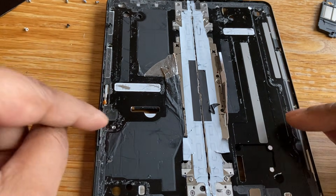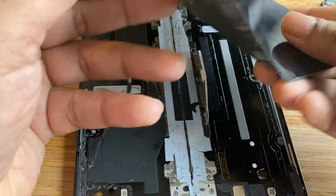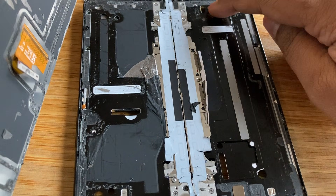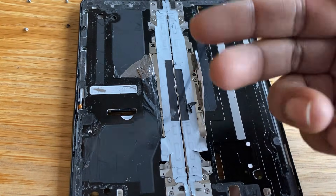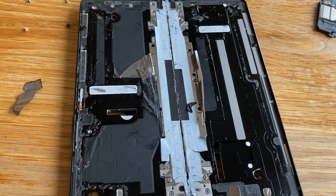So what's next is we're basically going to have to get this folding screen. Remember it was glued in so we need to get it stuck back down. Feed the relevant clips through — this one feeds through this gap, the other one through this gap, and the other one through the gap up here. Feed the ribbon cables for the screen in. Reposition the screen and glue it back down — glue around all the places you saw it was glued. Then put the trim back in and put the hinge stoppers or whatever you want to call them — these little things right here. And then do everything in reverse.